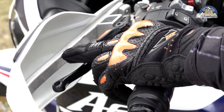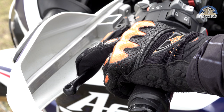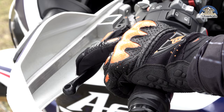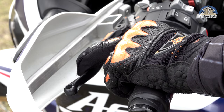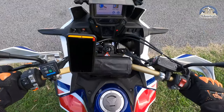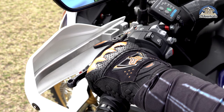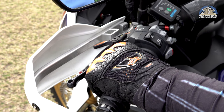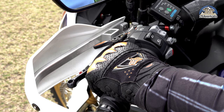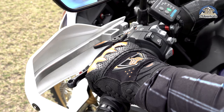The way I use this is to introduce some drag with one finger. This took some getting used to, so what I did was move it to the second position. I adjusted the cable so that the rear wheel would stop turning when it was on the centre stand, and I knew that then I'd cancel out the DCT.